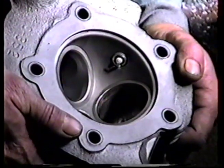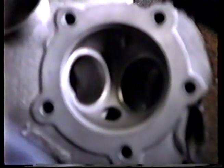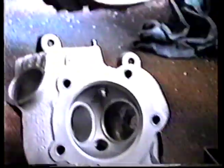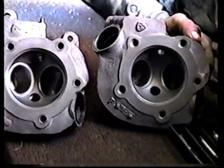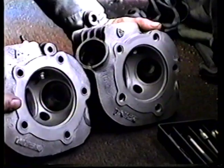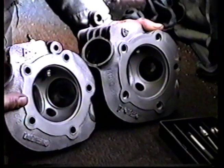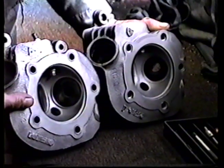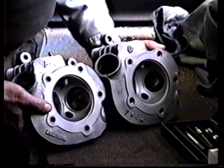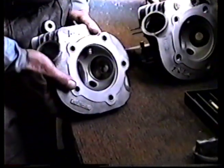Especially for guys that have the big inch motors — they really need to get every bit they can get. Here's a stock one so you can see the difference in the size of the intake — it's considerably bigger. We make the valves for these ourselves right here. We use an inch and fifteen-sixteenths intake, which is a standard shovelhead size valve. We also put them in pan heads as well when we no-lead convert those heads. You can take a look in these ports — we're not completely finished with this pair, they've got a little ways to go.